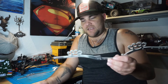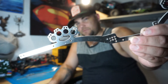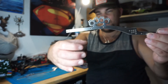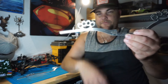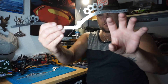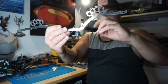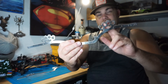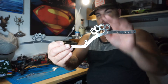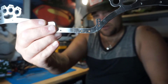I've seen a lot of nice ones out there — G-Speed has amazing ones. I like how they've got the G in the shock tower part. But just the different amount of spots I can put my shocks — because my axle will be about here, my shock could be fully forward, just full aggressive. Same up front. My axle will be about here and I can have that shock all the way over here — though that might be a little too aggressive. But I have all of these points to put my shocks, three different spots from my upper links up here.